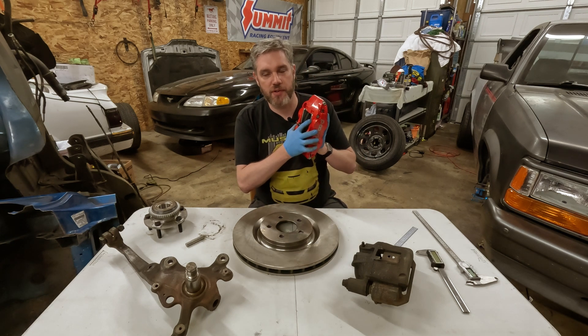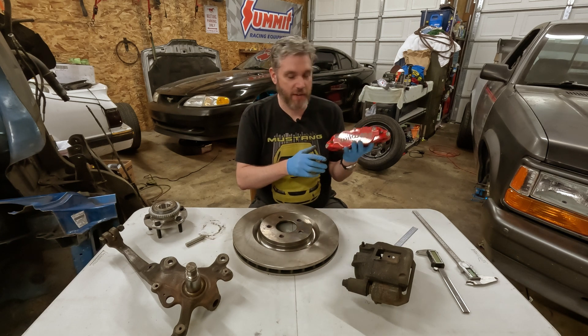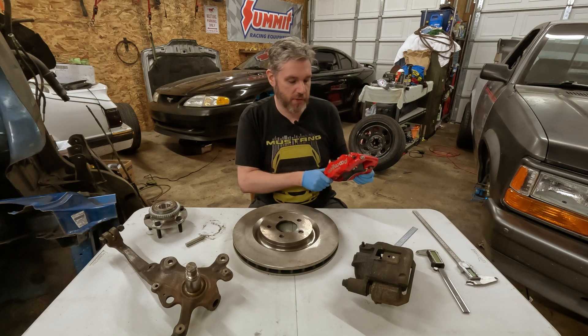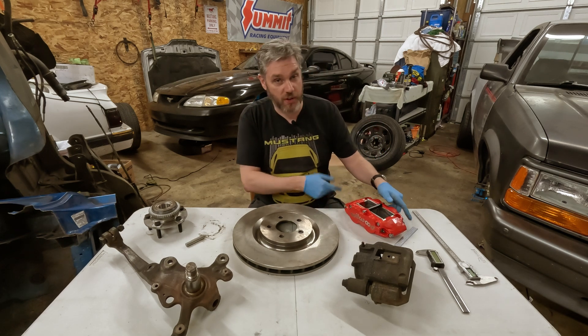Next up, you're going to need to get a brake caliper. I decided to go with this Wilwood Forged Narrow Superlite four-piston caliper. It's got a radial mount where the mounts come in at the top, which gives us the most amount of adjustability — we can shim it every which way if there are any variations in the parts. Best of all, these are relatively inexpensive for what they are — about 400 bucks. You can also get a six-piston version, so it's really versatile.